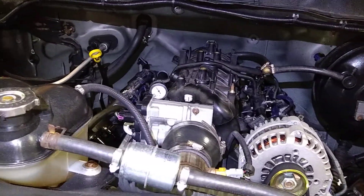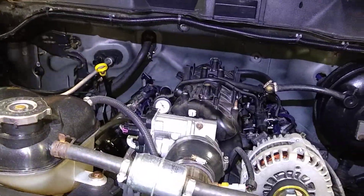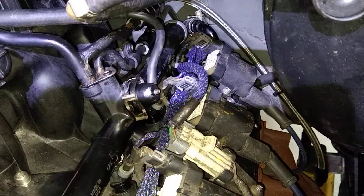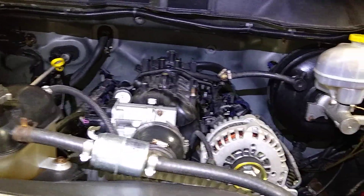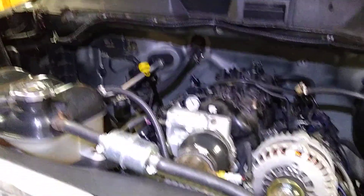As you can see, porting makes a pretty big difference. I thought it was 65 but it's around 70 pounds of pressure that it maintains — and that's with vacuum on the dome and with the set screw backed all the way out, so there's minimal to no pressure on that diaphragm. You can see that's what it ends up doing. I hope this helps — let me know if it works out for you, Matt.